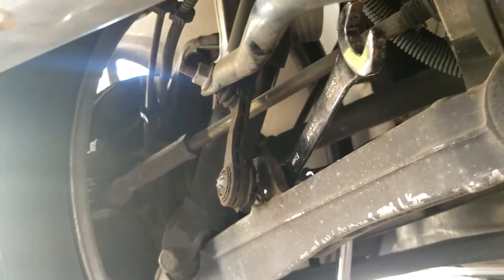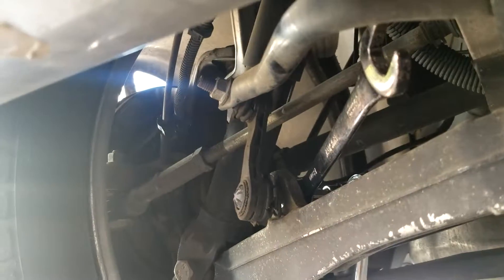I'm going to go ahead and uninstall this and install the new one and show you the finished product. Hey guys, I didn't show a picture of the final product, but it looks just like the old one did — but thicker. It was a pain in the ass to install the rear one. I couldn't torque the end link to the A-arm properly — I had a hard time with that and had to just crank it down. I also had to remove the exhaust to get to the bolts that hold the bushing in on either side. Other than that, installation was pretty quick.